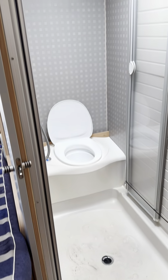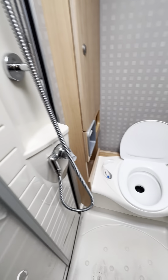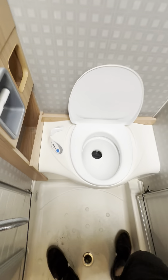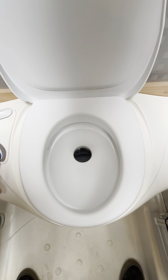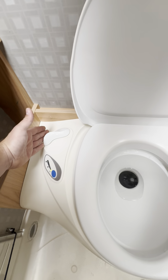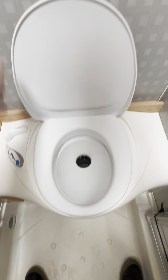The last thing is the bathroom. The bathrooms don't take very long — this is a hot and cold tap just like the sink, and the shower up there works the same way. The toilet is the only part I run through specifically since you might not have used one of these before. You do need water in your fresh tank to flush. Push the blue button just here — it pumps the flush fluid around to drain into the cassette, pull this handle towards you to drain everything into the cassette, then push it back away. That is all you have to do.